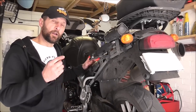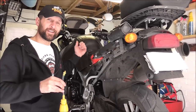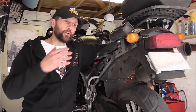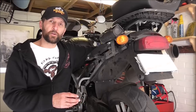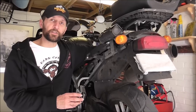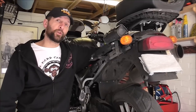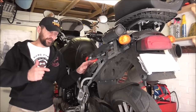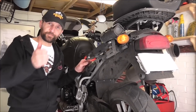You are going to go through that canister a lot quicker — probably one a week — but it doesn't matter. That pot of two-stroke oil cost me 99p or £1.99 from a supermarket, so it's cheap compared to Scott oil. And your chain won't be getting grit attached to it. A chain and sprocket set on your bike should last 35,000 to 40,000 miles comfortably if you look after it this way, or you can run them out in about 12,000 miles if you don't. At £130–£140 a set, that's a lot of money. I hope that helps — give it a try. If you find it's too much, just adjust the delivery accordingly. Ride safe, see you next time.